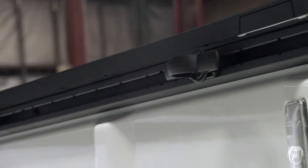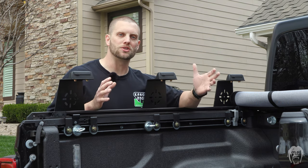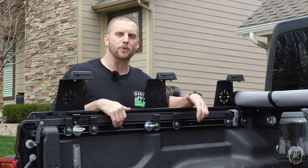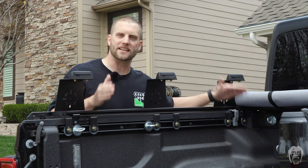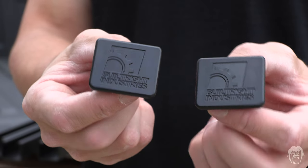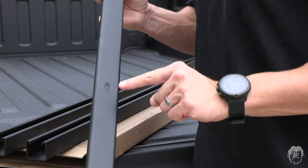My gripes with the Mopar kit are you can't put the tie-downs exactly where you need them, which limits how you can secure your loads. The tie-downs are bulky in an already tiny bed and you only get four of them. However, the Mopar kit does have a clean finish and will work for pedestrian use. The Built Right Industries cargo management system is basically custom unistrut that is pre-drilled and powder coated to fit the inside of the bed. The holes line up with existing mounting brackets in the bed and it fits nicely inside the interior, with the pre-cut pieces fitting exactly in the right spot. The kit comes with three pre-cut powder-coated rails, branded end caps, and a bag of cylindrical inclined planes.